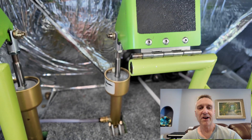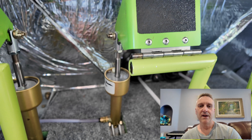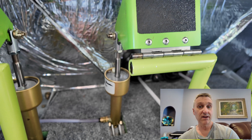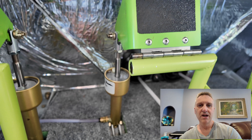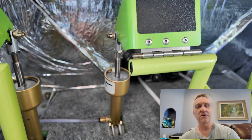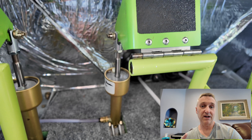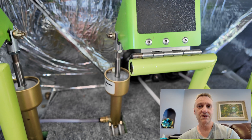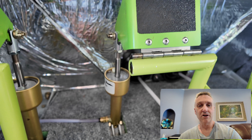Future Mike here. I forgot to mention on the master cylinders — Matco does sell something called an intensifier, which helps build pressure in the master cylinders for those that don't have the correct geometry. I do have the intensifiers installed. Before I installed the master cylinders on the airplane, I had sent them off to Matco ahead of time, knowing that the brakes could potentially be a little bit subpar. Just want to let you know that intensifiers are an option you can have installed in the master cylinders, and it may or may not help you. Your mileage may vary.